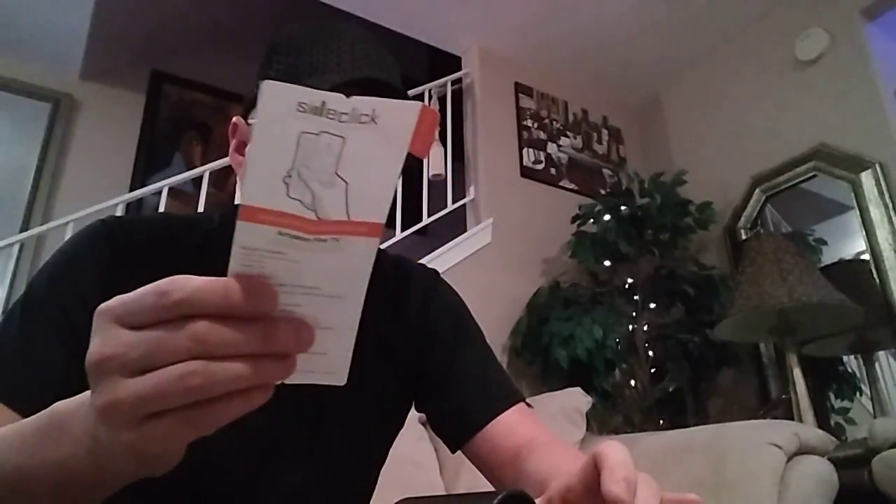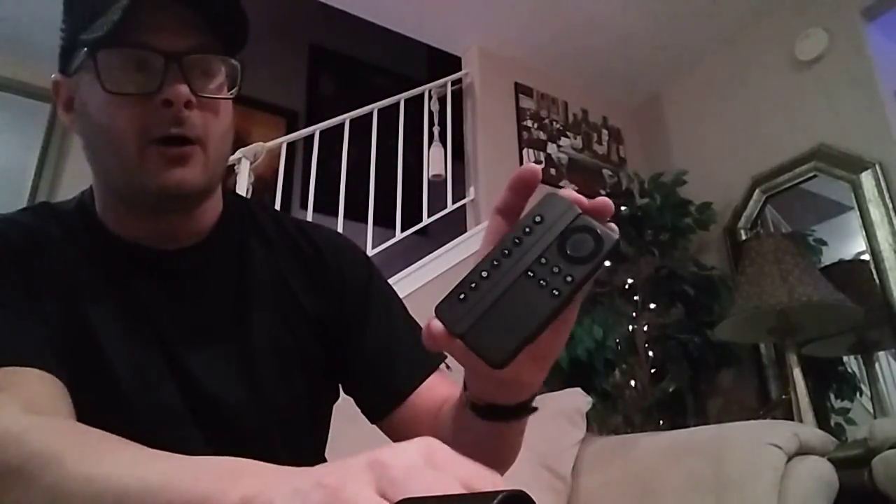You can see there is a red LED light on top — you hold Power and B until it's on. Then position the SideClick and the device remote you're learning from head to head, approximately one inch apart. Press and release the SideClick button you wish to program — the LED will start blinking. Then press and release the button you want to learn from, and the LED will blink three more times to confirm a successful learn. Then it returns to solid and you're ready to program other buttons.